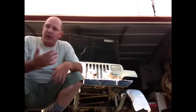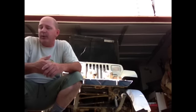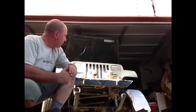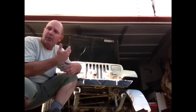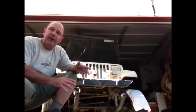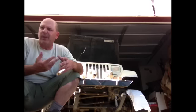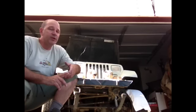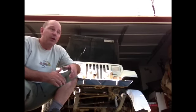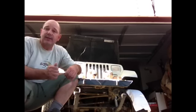We're slowly making progress, just a coat at a time. We've put about five coats of primer on the doors and have just started doing our base coats. We've got about two or three coats of primer on the Jeep itself. We did hit the front area a little more because of the abuse it takes from bugs and that kind of stuff. We started with 200 grit sandpaper to knock off the paint. The old paint job was really horrible — a lot of rough edges and bubbling. We've now been sanding between primer coats using 400 grit, and between base coats on the doors as well. Now we're going to start using 600 grit on the doors.